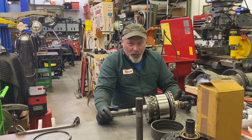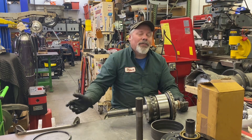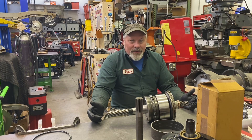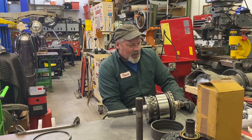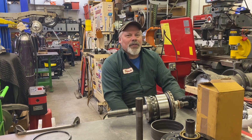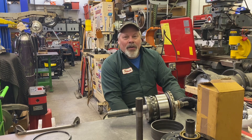Back to my point — I have another brand new TCI shield in a box. I have a Tom Waters shield — it's black, but the TCI is identical. I already have two ATI Bellhousings identical to what's on there, plenty of stock HD cases, and I have the rest covered with my valve body. I've already ordered a bunch of valve bodies to restock. I'll put in the ATD automatic transmission design brake — it'll be just like my other transmission, literally plug and play. And now I don't have to spend $2,000.